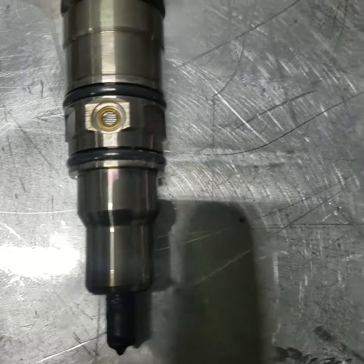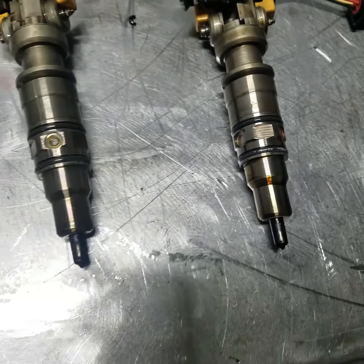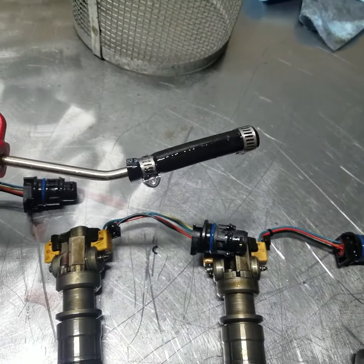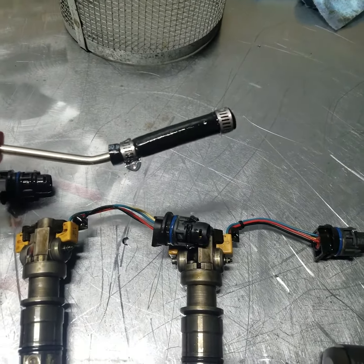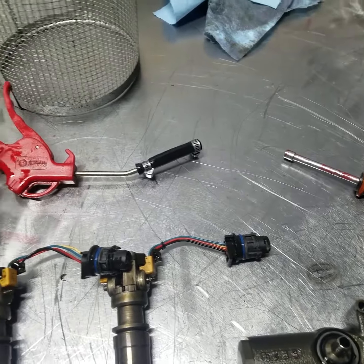These all look pretty good. So we're going to verify everything at the cups and then we're going to pressure test these injectors. This is kind of a crude setup, but since we were seeing so much fuel get by, we're just going to look and see if these injectors — normally closed — are going to allow any shop air through at about 120 PSI.